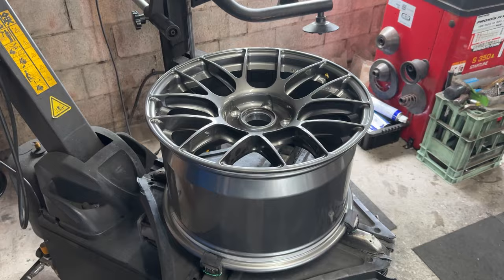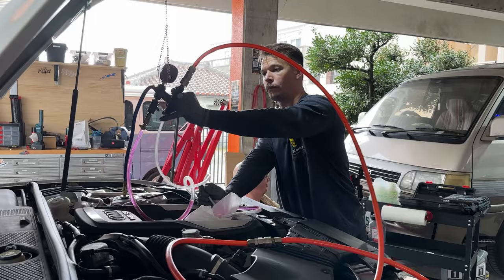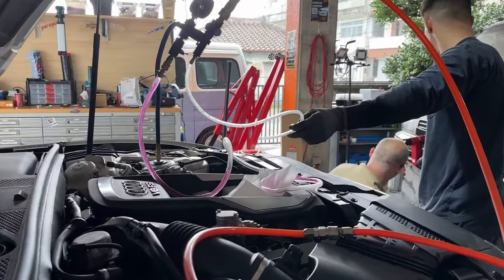All I'm trying to do is correct and get as much negative camber out of the wheels as possible, so I have more grip in the corner and more even tire wear on my 18-inch wheels. To do that, I'm going to go see my friends Brandon and Andy at V8 Car Shop Okinawa and they're going to help me out with this.